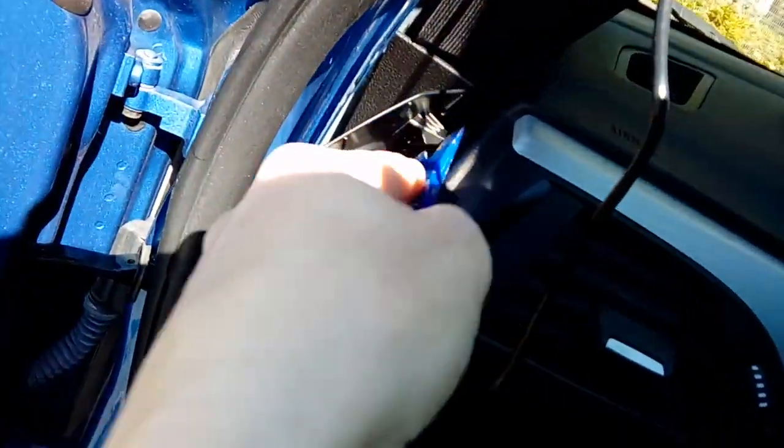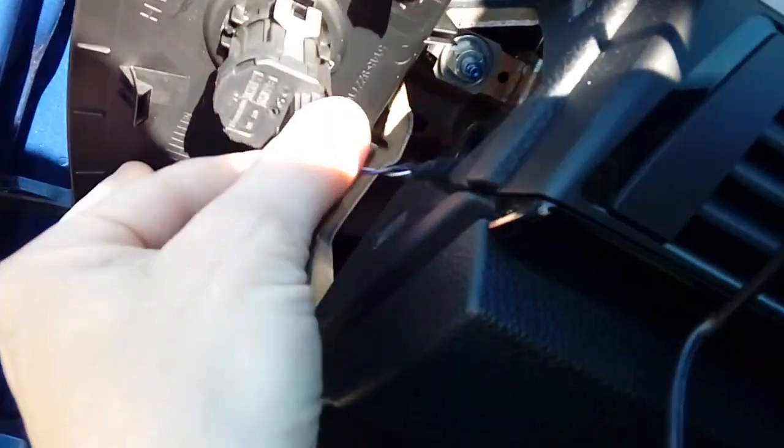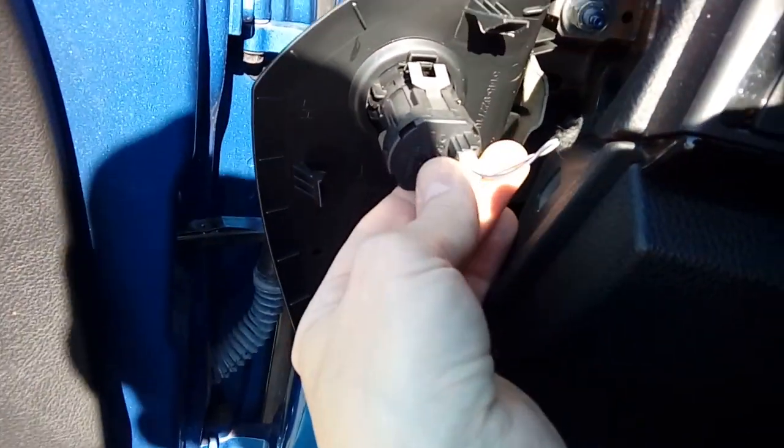Come around here, slide your lever device in, then pop all the way around — you'll hear it pop. Pull your rubber off. The top clips are normally a bit of a pig. Do not unplug the airbag connector. Leave it plugged in, because if you forget and switch your ignition on you're going to have to go to a garage to get the warning light switched off.